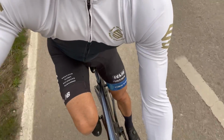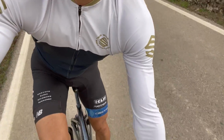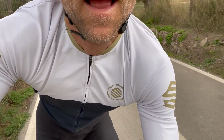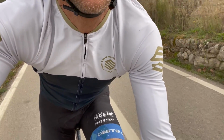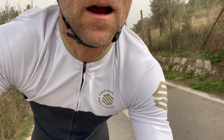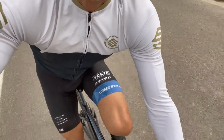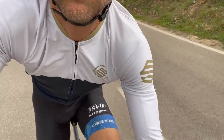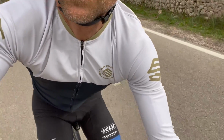The discs, yeah, the rubbing discs. When I put this 49mm back on for the first time, it was in the morning just before a group ride. I thought, oh, that'll just slot straight in, and lo and behold, it rubbed like a bastard, which is ridiculous because it's the same exact wheel with the same exact disc. I'd managed to get the other one not rubbing, and this one should not have rubbed either, but it was very slightly warped out of the packet, so I had to rapidly adjust it a bit so it didn't rub, but it wasn't perfect. And then all the delay meant I had to do a 10k time trial solo to catch the group, so I wasn't super chuffed about that.